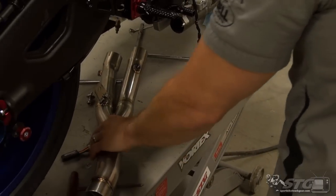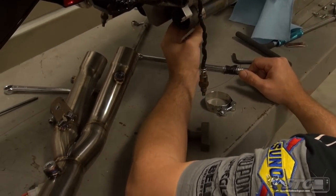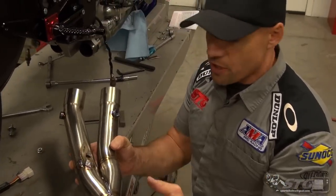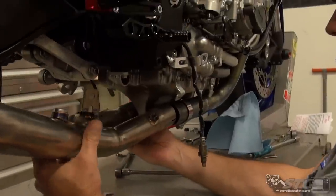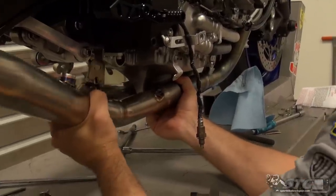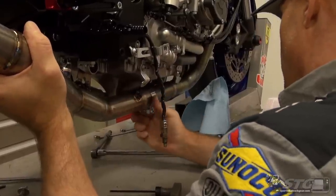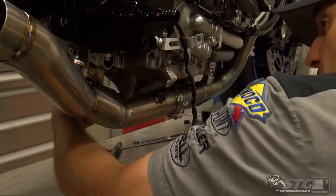Before we start this motorcycle, I'm also going to clean all of my fingerprints off the pipe — that is titanium, and if we leave those fingerprints on there, they will essentially discolor the pipe and cook into it. Now with the anti-seize, we want to put a light film inside the pipe where it slides over the other — this just makes it a lot easier to pull apart in the future for maintenance or crash damage. I found the easiest way to install this was to kind of get it started lightly on the other side, hold it back here, give it a little pull while putting some forward pressure, then slide it on up to the clamps.